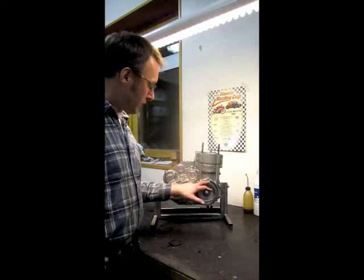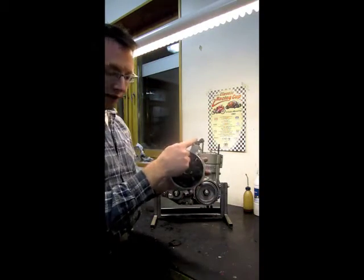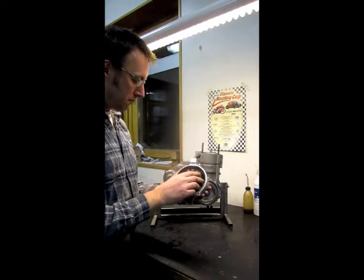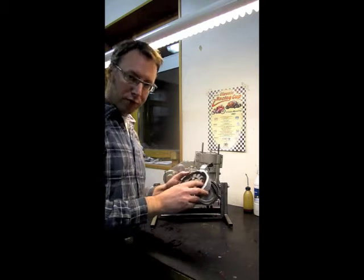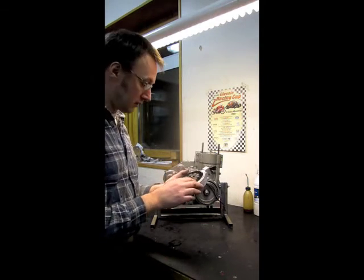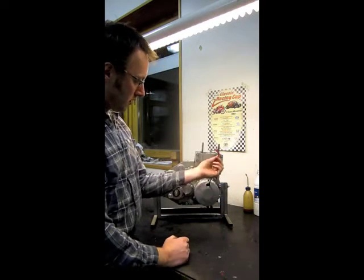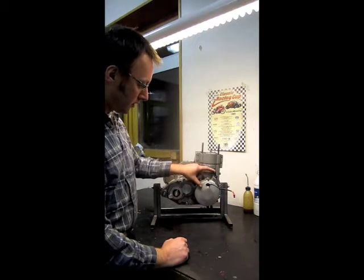I've been using a flywheel from SEM that they originally made for the Cannondale project, which out of commercial reasons didn't turn out to be anything. The same engine is now working as the 450 from Highland. To pick up the signal, I needed to assemble a VR sensor on the stock cover. The alternator wires go here and the VR sensor connects here.